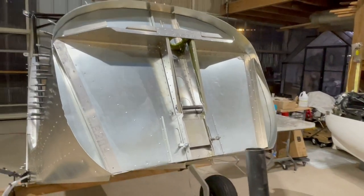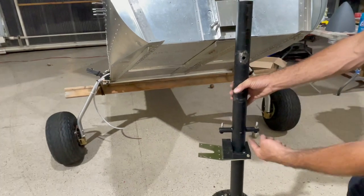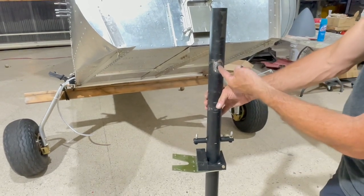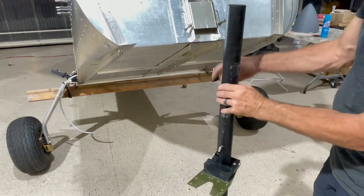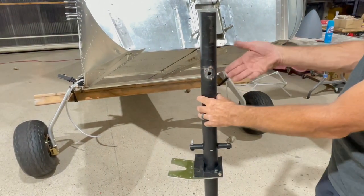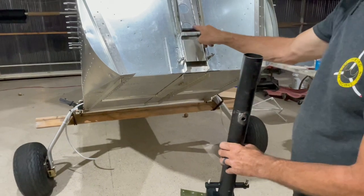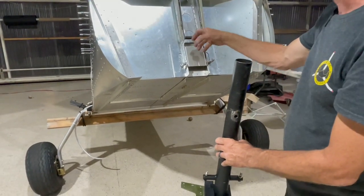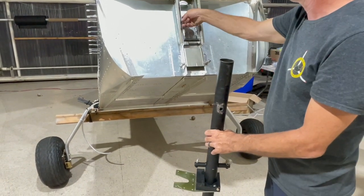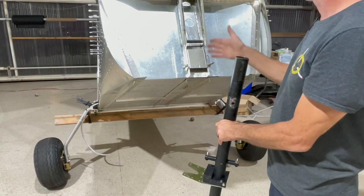When they went away from the steel bungee, there was no longer a tube here — 23 and a quarter inches from the center of this tube up to here. There used to be a tube that went right through, sticking out on this side and the back, where you would loop your bungee. The bungee would go around that, down and around this, which is the original location where the force was transferred — and it's also where the steel bungee picks up the force through these two straps on the side.